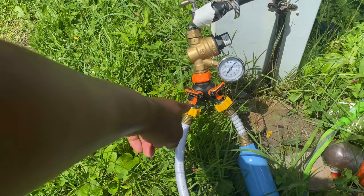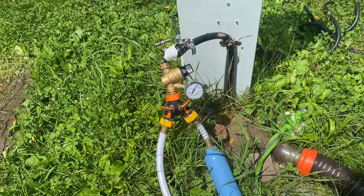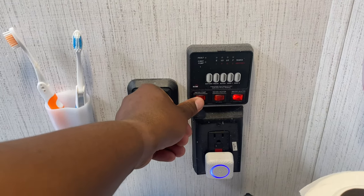A step I didn't show was cutting off the city water connection and the connection leading to the fresh water tank. As you can see from the spigot, both terminals are turned off. Now we're going to turn on the water pump. While you're draining the water you want to have your gray tank valve open because you have to flush the tank — you need to empty out the fresh water tank, so you need a valve open to collect the water.